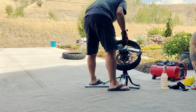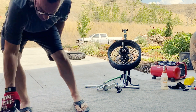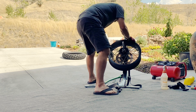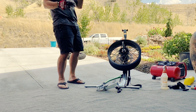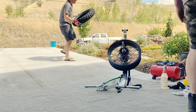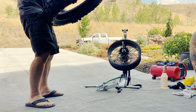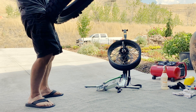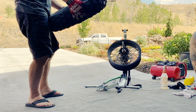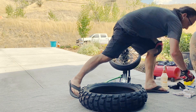The old tire's off — just took a couple of minutes. I'm going to take a rag and give that a quick look and a quick wipe, and that is all there is to that. So a new tire comes in — tire rotates this way. Double check: disc is on the right, sprockets on the left, tire is going to rotate this way, direction goes this way. Michelin often don't have a dot — I don't see a dot or balance mark on there; they're made to good standards.